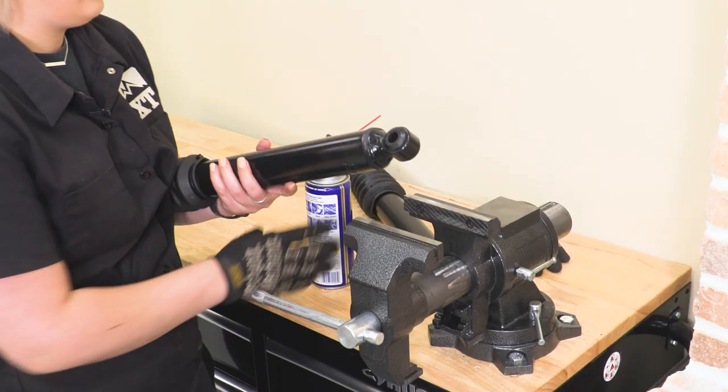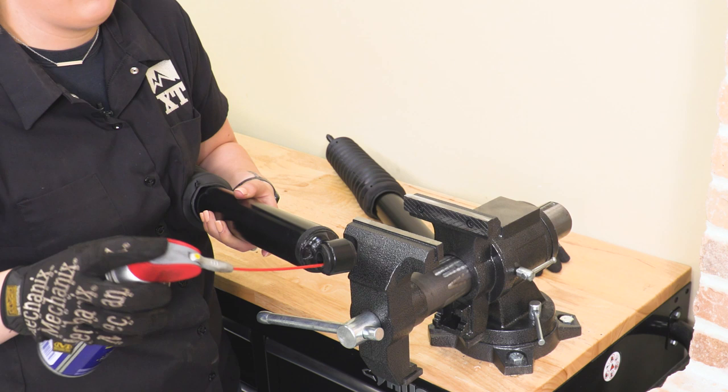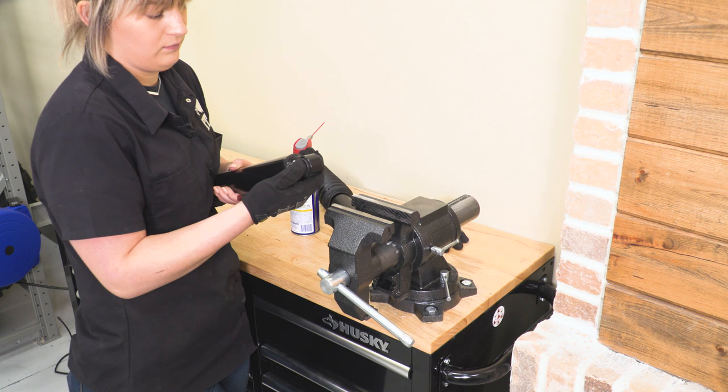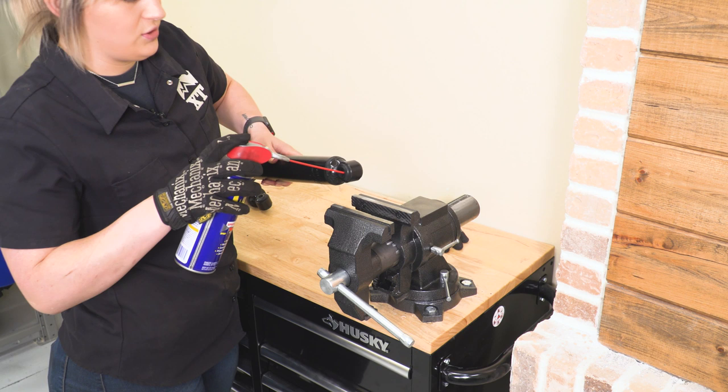Open up the vise and press in the metal sleeve — first prepare the bushing with a little bit of lubricant so the metal sleeve goes in easy, position it where we need it, and tighten up our vise. Once that's sitting in place nicely, do the same thing for the other front shock. Rear shocks are going to be a little bit different — we have bar pins for those, which I'll show you when we get to the rear, but it will be a similar process.